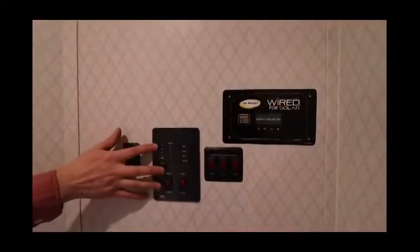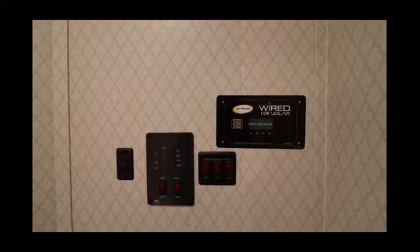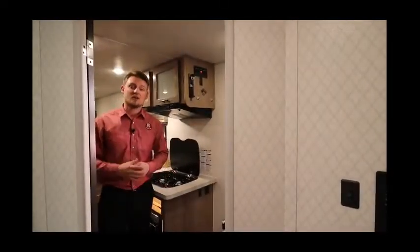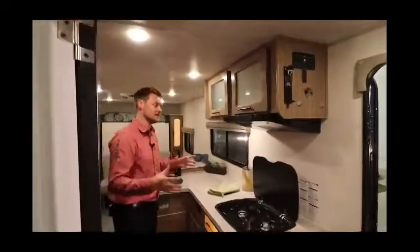One more thing that I want to show you in this bathroom is actually just on the wall here. So you'll see you have your control panel in here. You have a light switch for the lights in here, your control panel, and just beside that, you'll have your tank heater switches. So what Nobo has done for you is they enclose the underbellies of these trailers and they spray foam insulate them. And an option that we've added is every single tank on this trailer has 12 volt heat pads on it. So it's great if you want to go out into that early spring camping or late fall camping, you're set to do so. Follow me out this way and we'll talk a little bit about this great kitchen here.